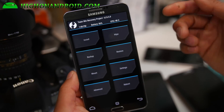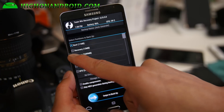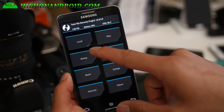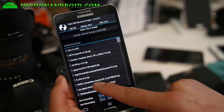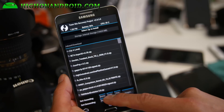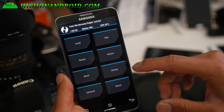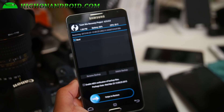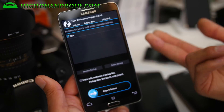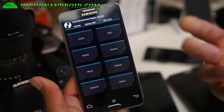There is a way to back up your stock kernel or whatever kernel you're running right now. Go to Backup, and what you can do is just Backup Boot — this is your kernel. Go ahead and back it up before you install the new one. Then next, going to install it — you will install the LKHLT, or LKHLT-CM for the AOSP version. Go ahead and install it and reboot. If for some reason it doesn't boot, you can go ahead and boot into TWRP Recovery. You don't have to restore your whole ROM — just go to Restore, and then go ahead and restore your boot, which is pretty much the kernel for Samsung phones. Then you'll be back on whatever ROM plus kernel you were on.